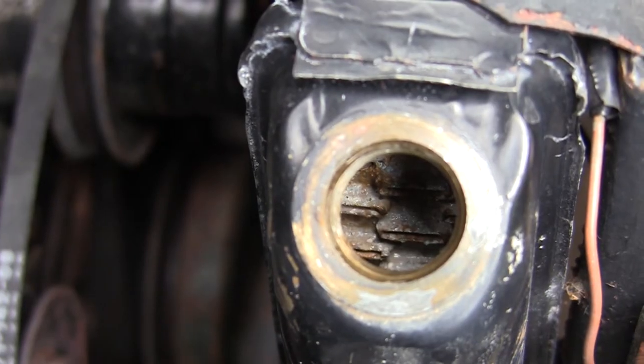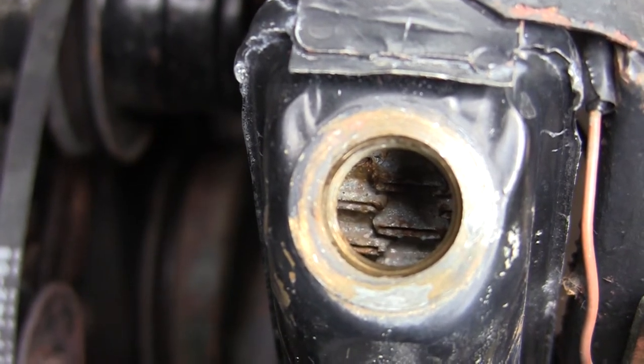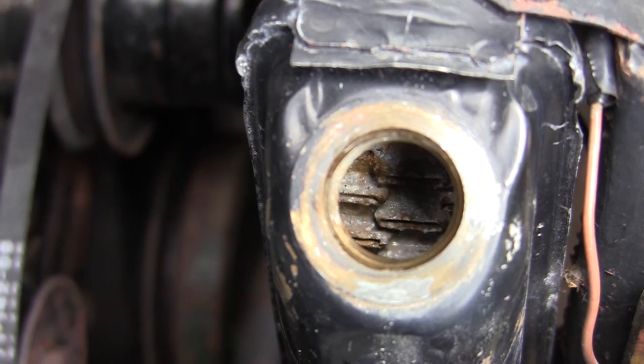So that's the water drained — quite dirty. We flushed it with just fresh water and then back-flushed the radiator. I was quite surprised how much rusty water came out when we back-flushed it. So what we need to do now is put the chemical flush into the system, top it up with fresh water, run the engine. The product said 10 minutes, so I've put that in. There's a bit of scale in there and hopefully the chemical flush will remove some of that and improve performance.